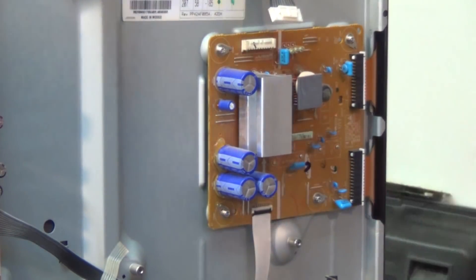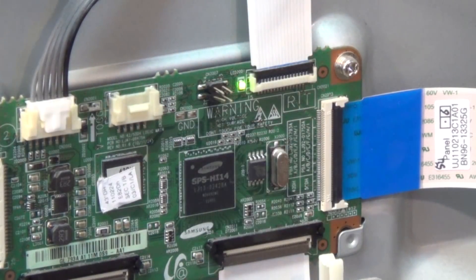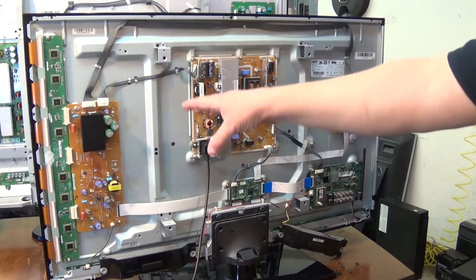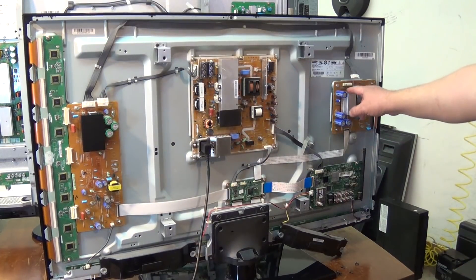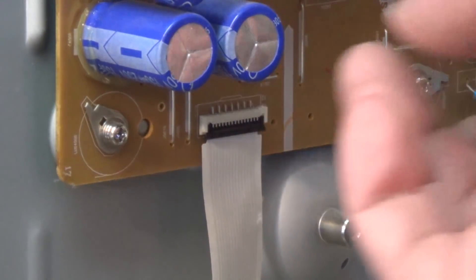At this point it's pretty clear that the fault is on the X main board, because the only board that's disconnected is the X main board. Now you can see my status light is flashing LED 2001. Normally when the set is healthy that flashes at about one hertz — on, off, on, off. But when the set is under fault it goes down to this slow flash, which indicates a fault on either the buffer, Y main, or X main board. In this case the X main is disconnected, so we know that's where the fault is.